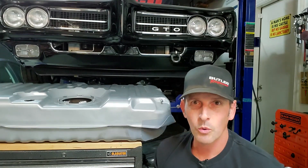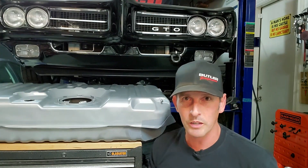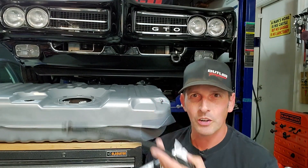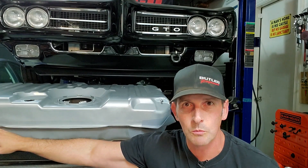Hey guys, welcome back to Fast Monty's Garage, episode 3 of our Rick's tank install with a Gen 5 Camaro LS3 pump. I covered all the details — the wiring harness, AN hose line plumbing — in episode 1, so go check that out. In summary: this is a currently produced pump so reliability is really high; you can run down to one gallon of fuel in your tank; there's no return line, just one line coming out; and I elected to get corner pickups, which is why I went with this restomod tank from Rick's.